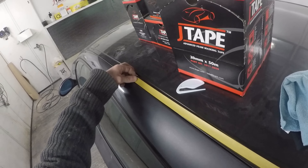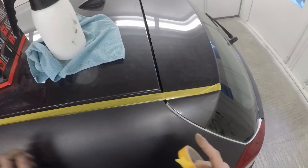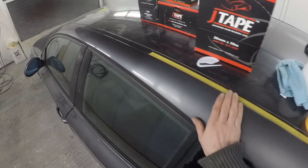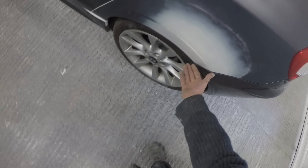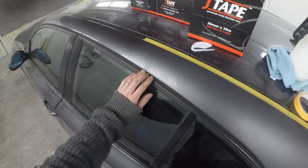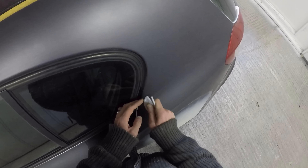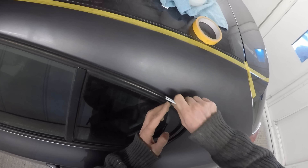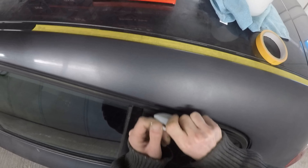Along the roof line I'm going to use the 100-degree orange masking tape, which is a hybrid between masking tape and fine line. It has an exceptional adhesive, especially around window rubbers — if you've got tricky rubbers or a quarter glass that won't come out, this is perfect. It's always a problem area for painters that normal masking tape doesn't stick well to rubber, but if you panel-wipe the rubber first and then apply the 100-degree tape it will stick really well. Personally, trying to back tape these edges often ends up giving a hard line.